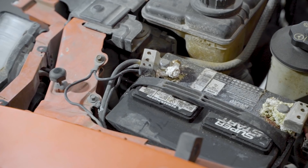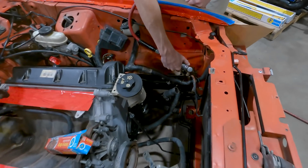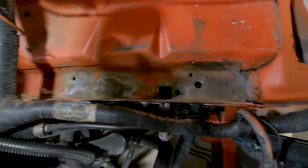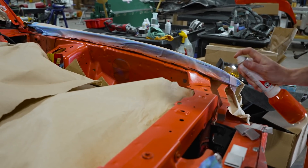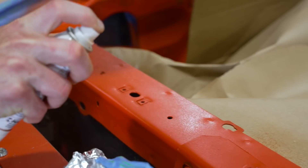One of the main areas we had to fix regardless was what appeared to be some battery acid leaking, because it had made its way past the battery tray down into that frame rail. It had really eaten it up, but we were kind of able to save it. We used a grinder, some sandpaper, prepped it, removed most of the rust that we could, and then came back with a primer sealer and shot the engine bay — except for the firewall, which for the most part still looked pretty good considering the car's age.